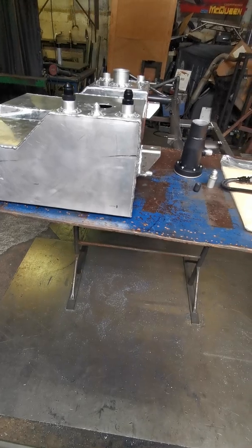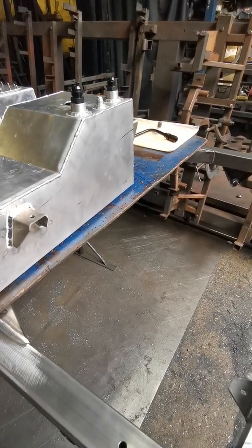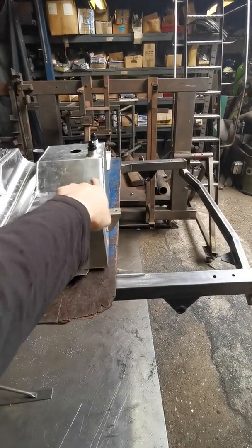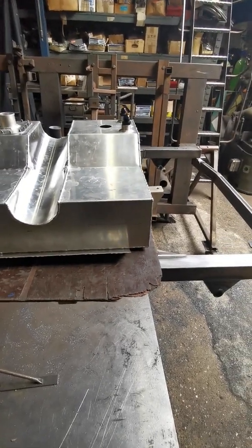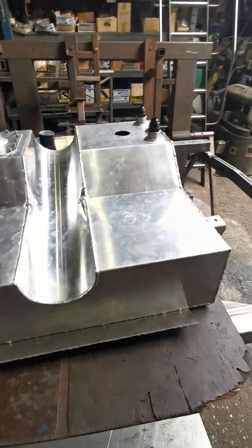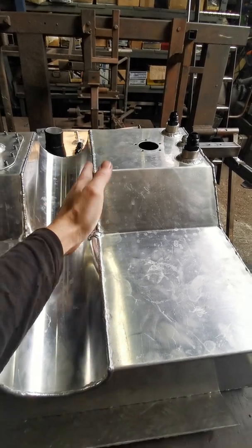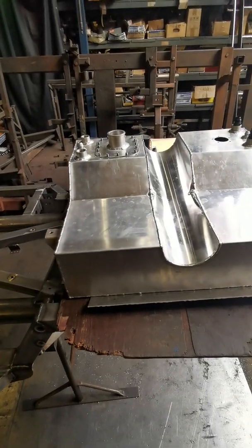When I came to the tank I had a few ideas. I wanted to drop some weight, and I also wanted to redo the exhaust because currently the exhaust comes around the current fuel tank. I wanted to make it as straight as possible and then go straight out the back of the car — a bit flatter underneath, slightly less weight overall, and then when I build the rear diffuser it'll be a lot better at the back. The idea is the exhaust pipe comes along here, goes up here; I'll have this all gold-lined and the exhaust will be heat-wrapped as well just in case.